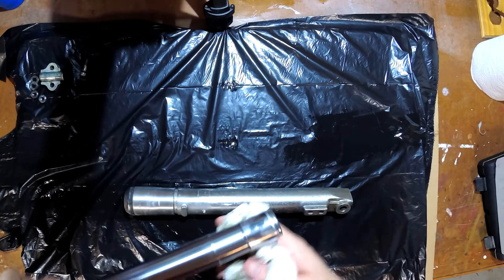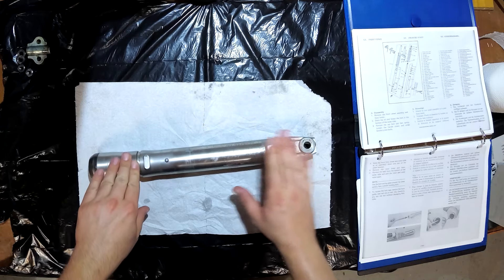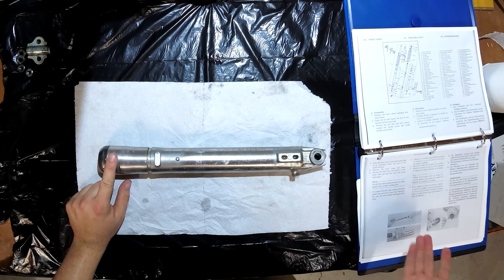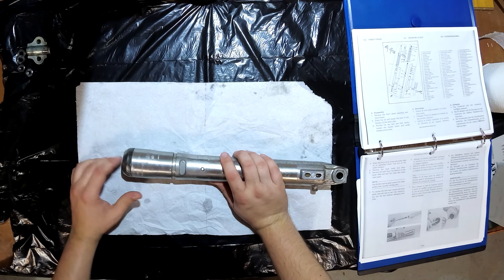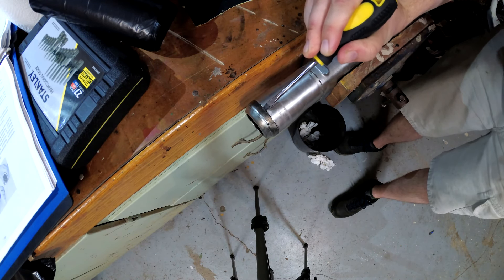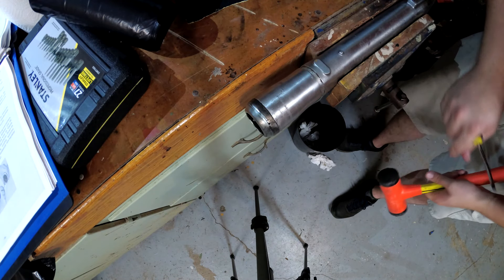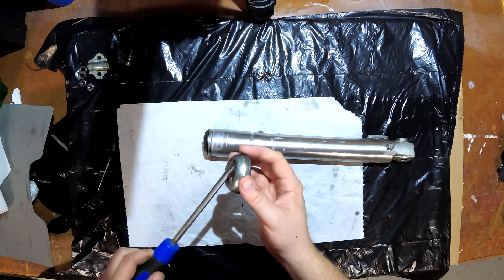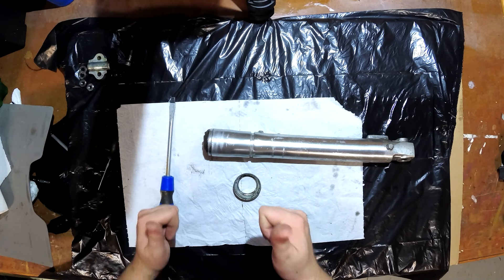I don't like taking my bike apart. It's all fun. I've got the fork lower in front of me. I have the service manual and now I have to get this metal cap off. The service manual actually tells you to use a flathead screwdriver — kind of wedge it in here and tap at it with a rubber mallet. I really hope this works and I don't just end up breaking more stuff. All this hammering on suspension parts. All righty, I got the cover off. I just used a big screwdriver and pried it out — it came out really easily. Nothing's damaged. That's always good.